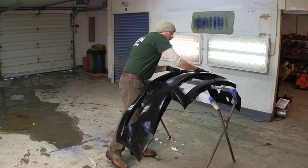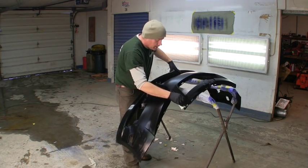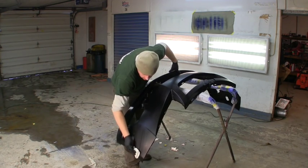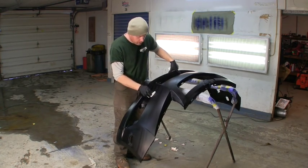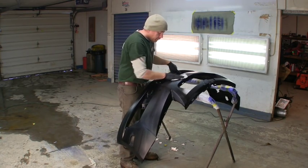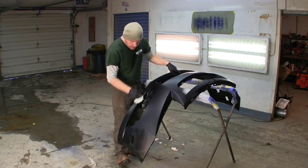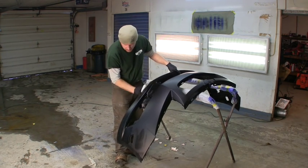It's really pretty cold. It got down to 40 in the shop last week. I kept the fire going but in an effort to let it go all night I couldn't run it real hard, so everything got kind of cold in here. This panel wipe is real cold — if you don't wipe it off real good it'll be kind of smeary. That's why after I'm done wiping these down and before I paint, I'll wipe them with glass cleaner. This is also kind of an anti-static wipe.